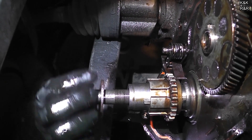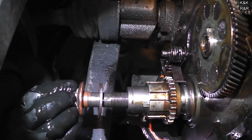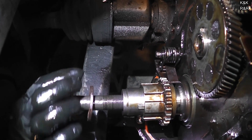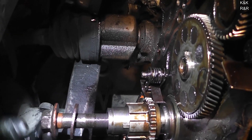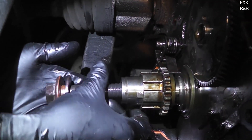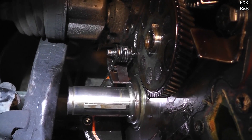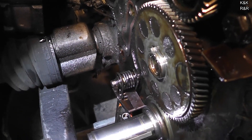Now we're going to remove our balancer bolt and slide the oil pump adapter gear off, because the oil pump is actually driven by this chain and collar. At least we know that thread will hold. Pull that sucker off. Alright, last order of business — that nasty tensioner.